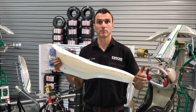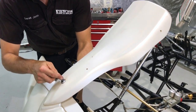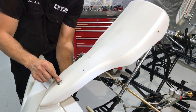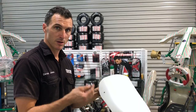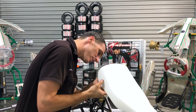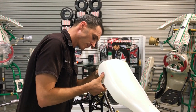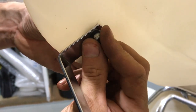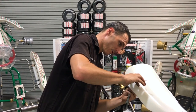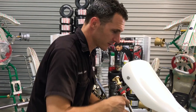Now we're all good to put the NASA panel on. First up, mount the NASA panel with the hardware — chuck that through there, little M6 nut on the bottom. Next up we've got the little M6 countersunk and the countersunk washer — stick it through there, move the bracket up, chuck it through the hole, and chuck your nut on the back. Then just do the nut up on the other side. For this one you'll need the 4mm Allen key and the 10mm ratchet ring spanner.